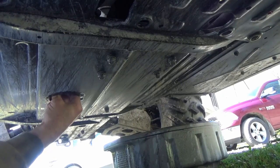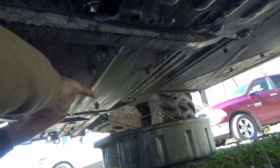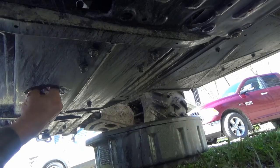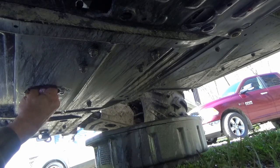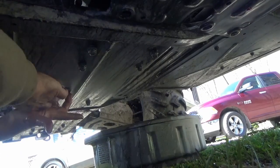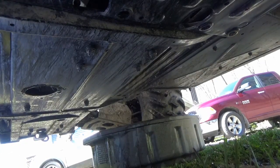This whole drain plug is aluminum, so you really have to be careful when you're taking this out because it will damage easily, and you definitely don't want to cross-thread it. That took more effort than I really wanted. I recommend making sure you can tighten it up most of the way by hand to ensure it's not cross-threaded — any mistake could be expensive. Then we're going to snug that back down. This doesn't have to be very tight — I don't know what the torque specs are, but we're just going to snug it up. Now we're going to put oil back in it.